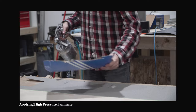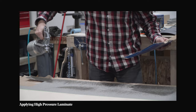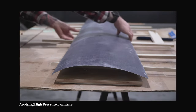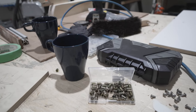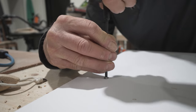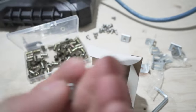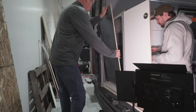When it comes to fastening it to the 8020, I wanted a hidden fastener system — basically attaching from the backside, not the front side, so you didn't see the fasteners coming through from the front. What I ended up using was these threaded inserts. I forget the exact dimensions, but I had to make sure they were less than half an inch because they needed to thread into my half inch panels. They are M4s, so I had to get matching M4 hardware. Once you have the threaded insert, a steel angle bracket, and all the matching hardware, it's actually pretty simple to install the panels.